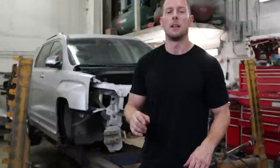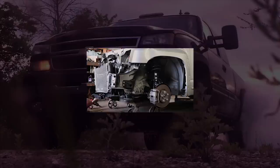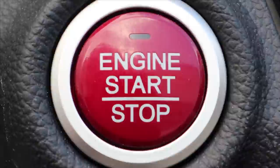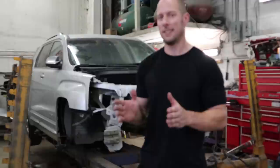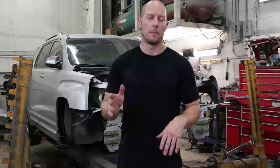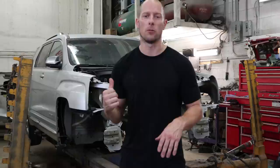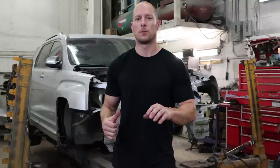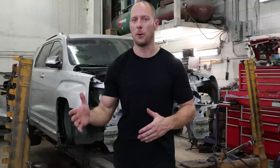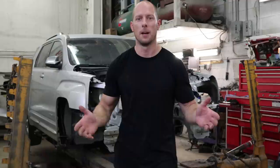I'm going to do the same thing on both sides. Now, these frame rails can be sectioned and straightened slightly, but not in the section where I'm straightening them. What I'm actually doing is an incorrect repair, and I'm doing this to show you that there are different ways to fix a vehicle. I can pull it over, get everything lined up, and be done, but the next time it's in an accident, the strength of the frame rails is compromised — it's going to fold right up. After I get done fixing it the wrong way, we're going to fix it the right way. Don't leave me comments telling me I'm doing this wrong, because I know. I'm doing this to illustrate how to do some pulls, but I only have a select number of cars to do this on, so I have to do it with stuff I'm going to end up throwing away. But you get the idea of how it works.